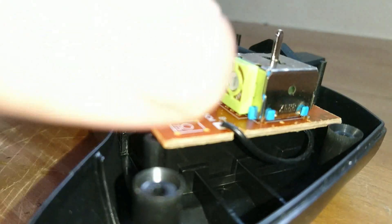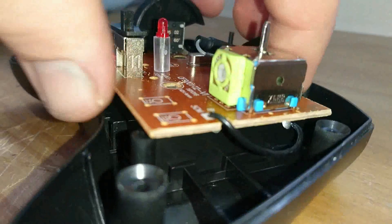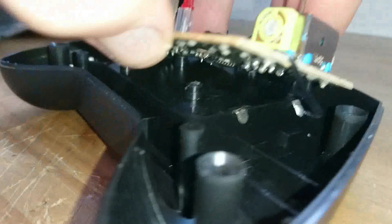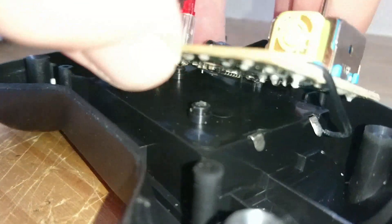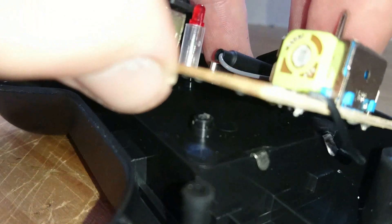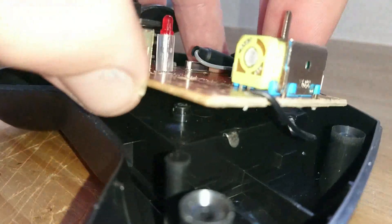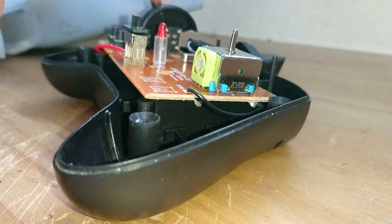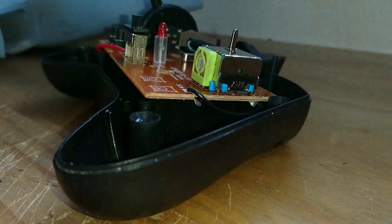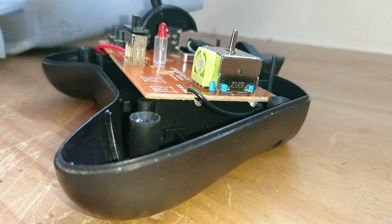If we take a quick look inside the board, you will see — I'm just trying to gently pull it off — the bottom side of the contacts of the board are right on top of the contact pins for the battery. So after a while, if you're pushing on the board, eventually you wear it down and those contacts start making contact.